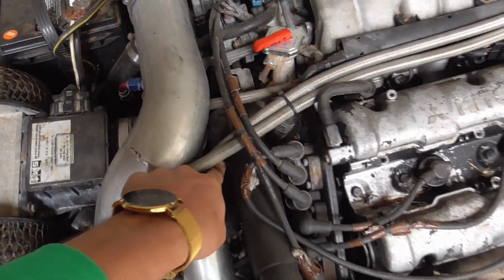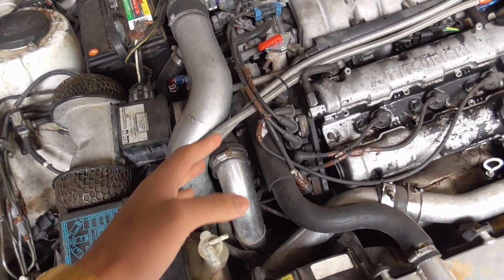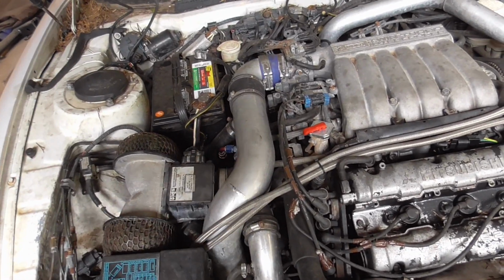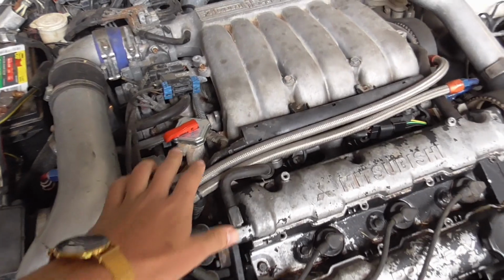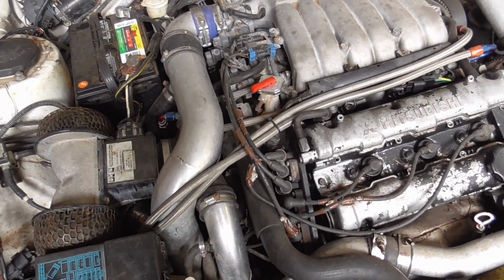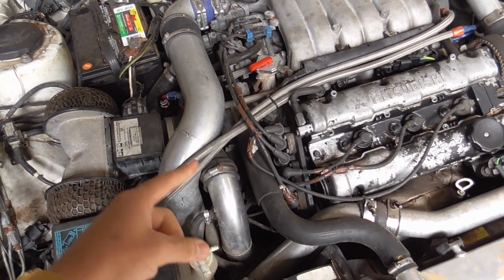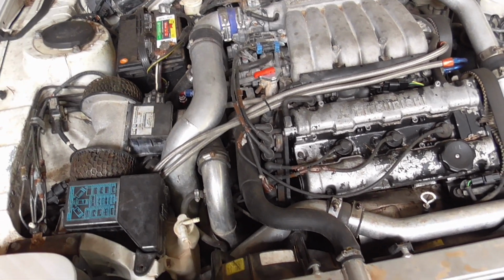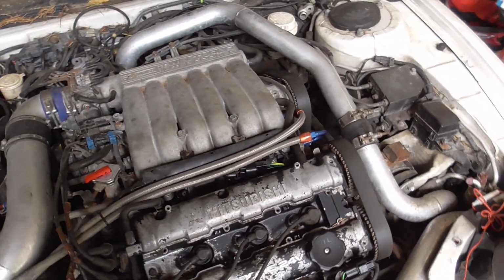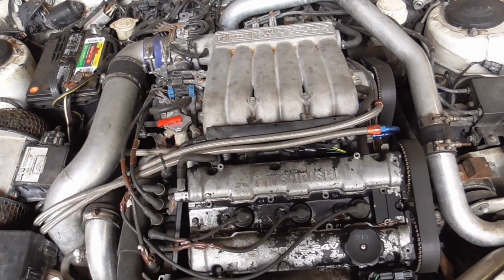Another kit that I'm ordering is for the big water pump neck assembly. It's not just the neck with this pipe, the radiator pipe coming out. It has a whole bunch of different attachments to run all the coolant through, because it all comes through the top here where you feed it. So I'm going to get a whole new assembly for that as well to simplify these, so I'm not mandated to stick with the lines that are there, but I'll have a little flexibility by running steel lines, which there are also steel AN lines as you can see here, that run for the fuel rail, which is great. That gives us that flexibility to work with those as well.